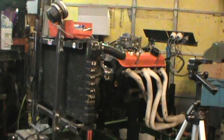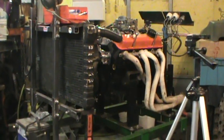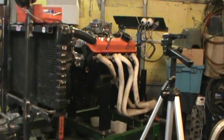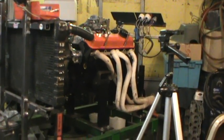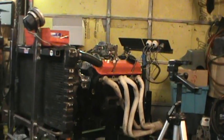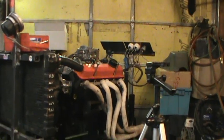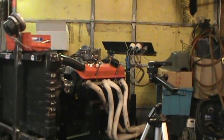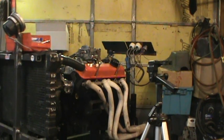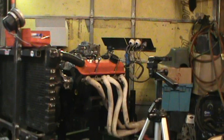This is Sunday, just a few hours before the live show, and I haven't done anything yet. I still got plug wires to go, the lower block water drain holes to plug, and we're getting ready to prime the oiling system right now. On the night of the live show I probably hadn't done the break-in, because that's just too long to do the break-in on camera, and that's too much fumes for me.